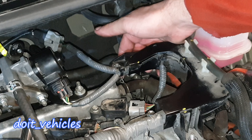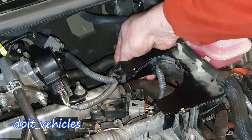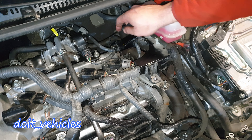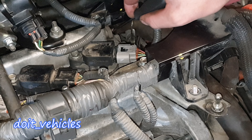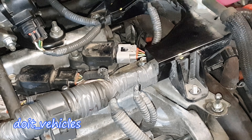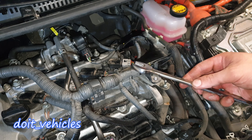As you can see, we've got a hose clamp here where my finger is. You can release this with your hand and just slide it apart. Use one of these picks to disconnect the hose, then make some space between the valve and the hose, and spray some silicone lubricant. Then it should come out.